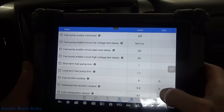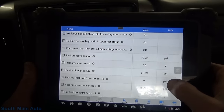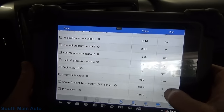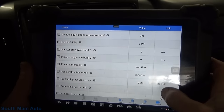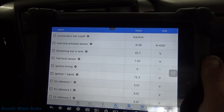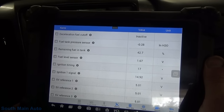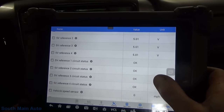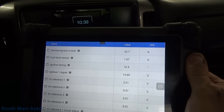So it's saying our ignition switch circuit voltage is low. Let's see if they have any voltage data PIDs in here. That's fuel pressure - so these are direct injections, they're going to work in the thousands of PSI. This is like the older GMs with the fuel pump drivers - there's only like two power wires back there. Here we go - ignition one signal voltage, 12.2. Let's just start it up. And that went right up to battery voltage.